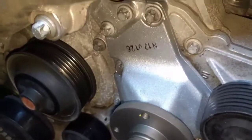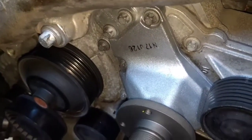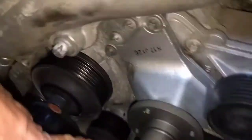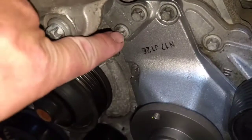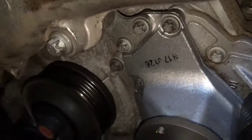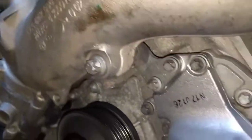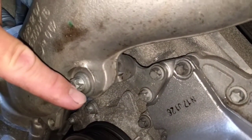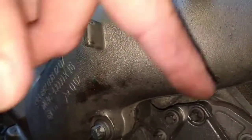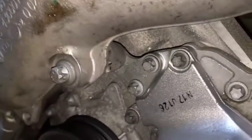Once I did that, there's the bracket itself. It's kind of funny. This is the bearing bracket itself. This is where the clutch fan screws on, and it has two threaded holes in the bracket that this little auxiliary bracket attaches to, if I can get my hand positioned just right. And all that does is this bolt from the intake manifold right here, coming from the intercooler back into the motor. Just that one bolt holds that little metal bracket.